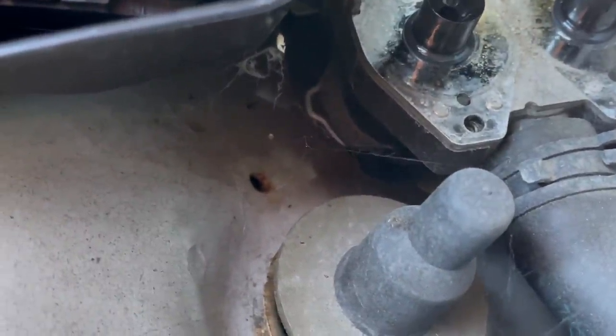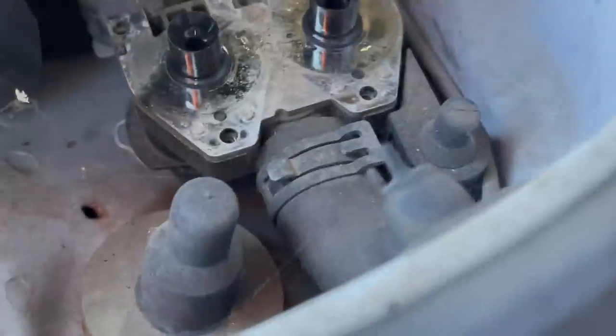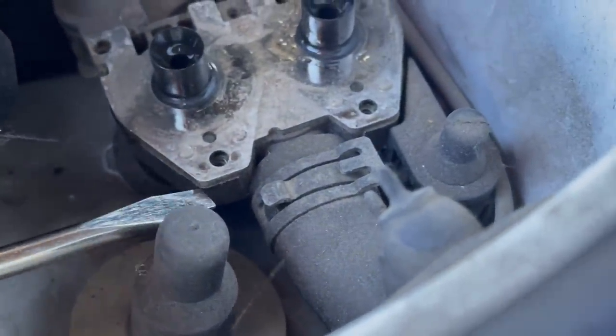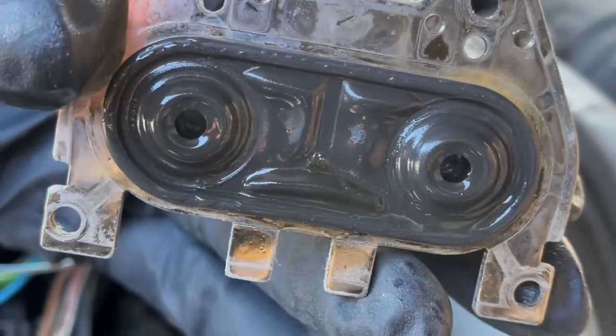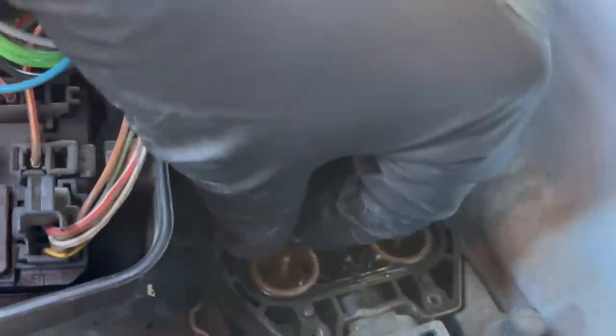Let's take this one out too. You got the spring on there — stay on there, little spring. That's the cover for your transmission, TCM, and computer and stuff. I just take that off; it gives you a little more access, and that becomes my tool holder. Now, this little metal plate should come up, and here's where you need your other tool — your little screwdriver. You just have to get under here. Very carefully, you loosen that with a screwdriver and this part just kind of comes up. See how dirty that is? This is a little gasket that you get in your kit. Sometimes you have to replace it, sometimes you don't. That's still fine. That's still good.